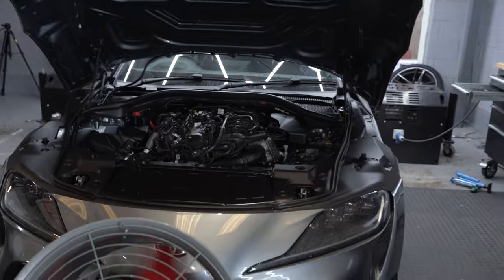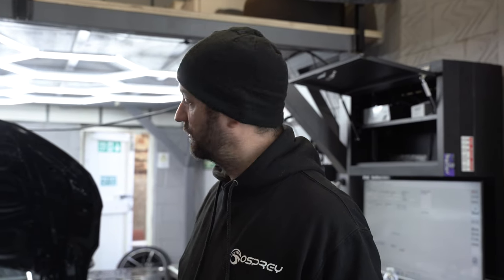Day two. Yeah, so, back on the dyno. Louis obviously took the car home last night. He went and played silly buggers on the road. He's done his 100 to 200. I think you got a 7.6. Yeah, 7.6. But you did log it and there was no timing correction. So you moved up to the 95 run map.